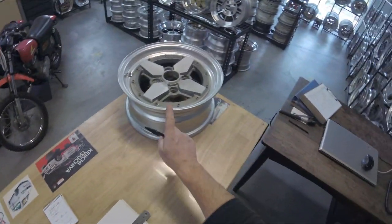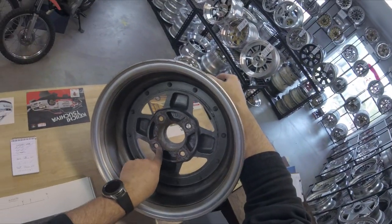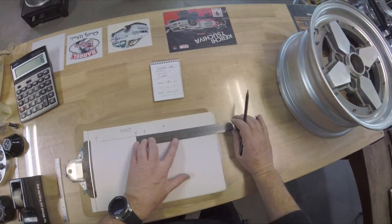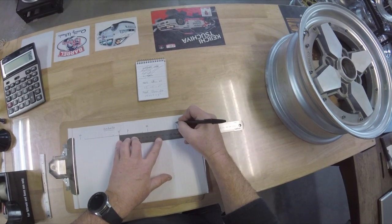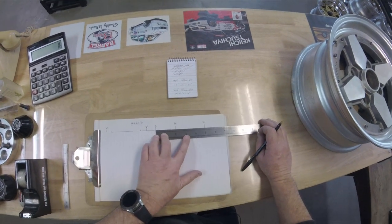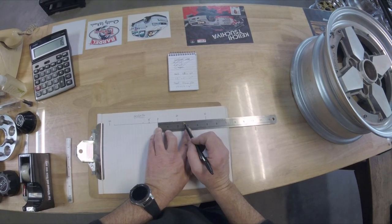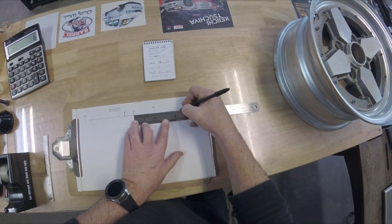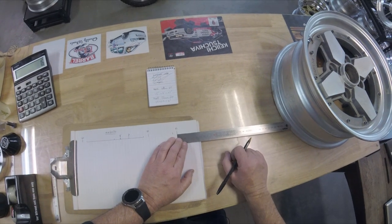On the rear we should be using these wheels. On the rear we had 148 millimetres. We know where our hub is, and the hub on the car is going to be in the same place as the hub on the wheel. So 148 millimetres - there's the rear guard. So the lip is one and a half, two, two and a half, three, three and a half, four, four and a half, five. Wrong - four and a half inch lip we worked out. So the actual lip will be about two millimetres outside the guard.